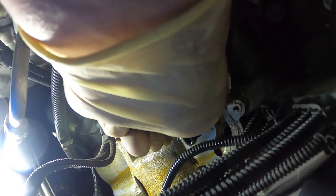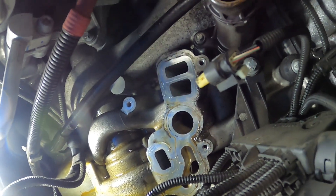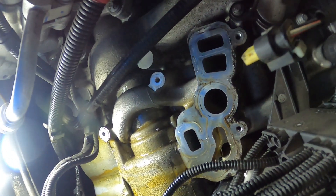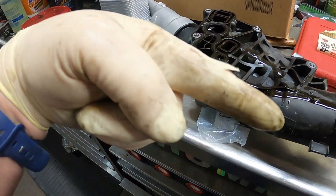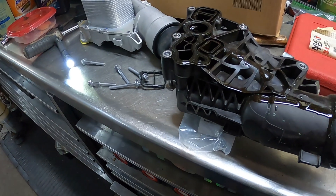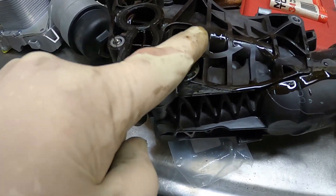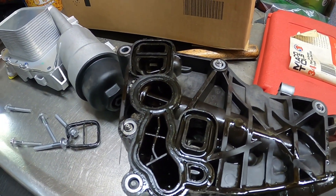It's still stuck to the block — get that out of here. Now of course I'm going to change the oil and change the coolant. So there you go everybody: if you have a mysterious coolant leak dripping off this area, it's most likely this oil filter cooler housing. I'm going to clean this all up and put it back together. Thanks for watching — please subscribe and give me a thumbs up. If you have one of these leaking, I would not even bother getting just the seals because you're going to have a plastic failure like that.